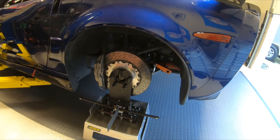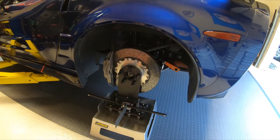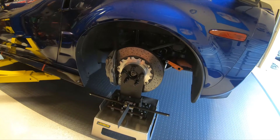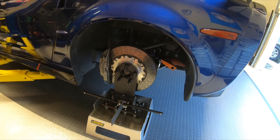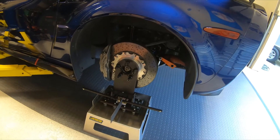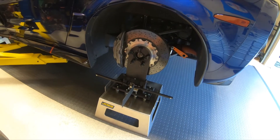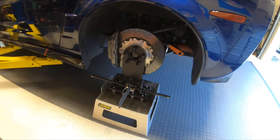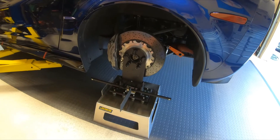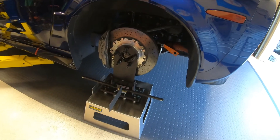You could do this on a floor. For camber, you need to make sure the floor is level — probably level within a sixteenth of an inch. If not, we use these stands that are designed for doing alignment. It makes it easier to get underneath the car, and you can use tiles underneath these stainless steel plates to level them if your floor is not level. This floor is level within a sixteenth of an inch so we don't need to do that.